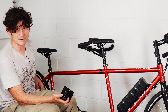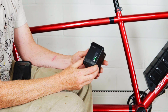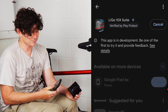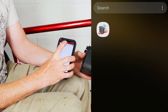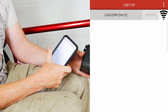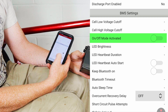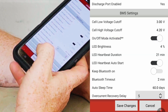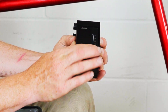To get these batteries into Bluetooth mode you need to press the button three times in fairly fast succession — one, two, three — and then you can see the blue wave pattern indicating that it's now broadcasting on Bluetooth. Once it's in Bluetooth mode, open the LIGO app which is available on both Android and iOS devices. With Bluetooth enabled you should see the serial number of the battery show up as an available LIGO module to click on. Inside there's a tab for the BMS settings, and inside the BMS settings there's an option for on/off mode. Enable on/off mode, save the changes, and now there's one additional behavior of this button. Get out of Bluetooth by just tapping it once.